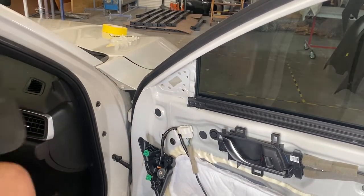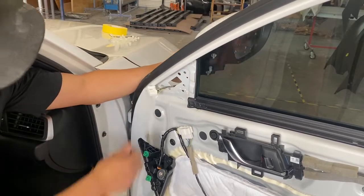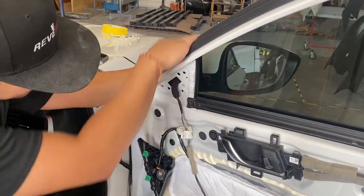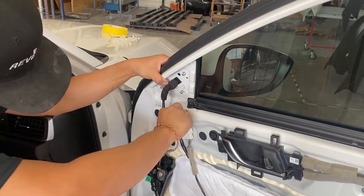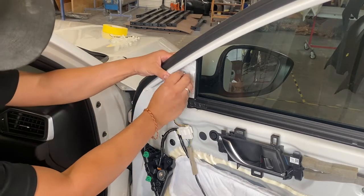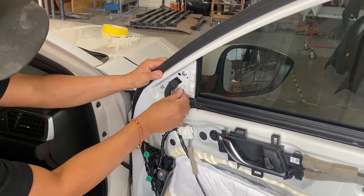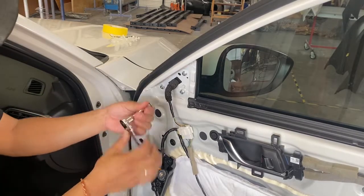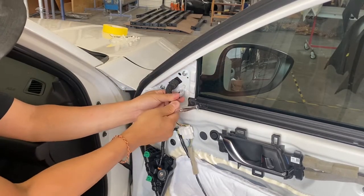So we're going to go in reverse on this one — we're going to install that mirror. Go ahead and put this through the loop right there, then look at the bolts. This is your clip right here — that's a guide basically. It should be going in there strong. Go ahead and clip it — you should hear that click. Once you hear that click, you're good to go. I like to avoid using a power tool here, because what happens is you over-torque it and then you break the studs. So go ahead and just use a socket. Once you feel it kind of grip, it's good to go.